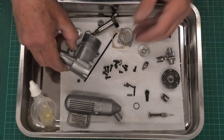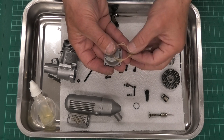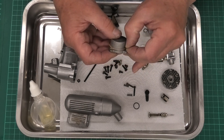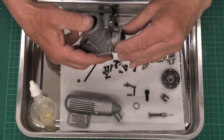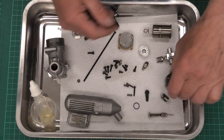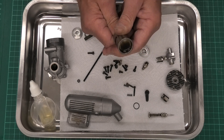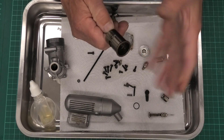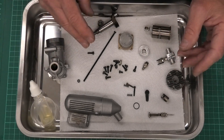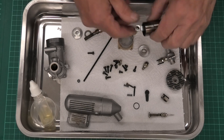This has all cleaned up nicely now and I'm really quite pleased with the way it's come up - it looks lovely. I've made a new gasket for the backplate. The head is polished on the outside edge so that looks nice. For the cylinder and piston I haven't done anything to it - it's a lovely fit in the cylinder, really pinches at the top. I've left the carbon on and haven't touched the cylinder because I think it's going to be a good fit with good compression, and I don't want to risk doing anything that will harm that.